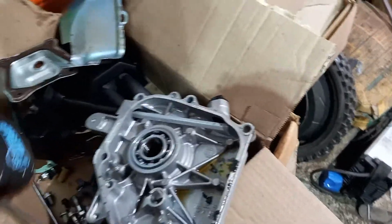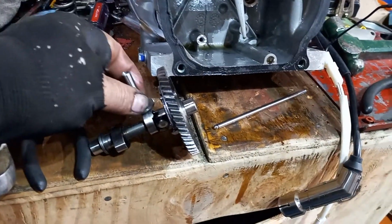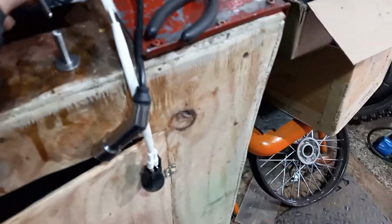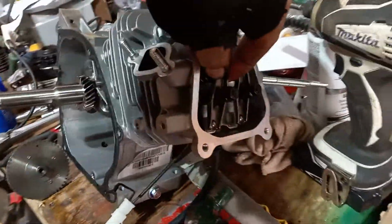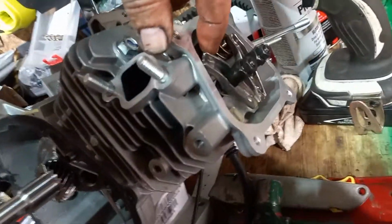Let me show you. They push these rods. Okay. So the lobe will push up on this, which pushes on this rod. I might as well keep this out because I want to show you something. Okay. Push up on this rod. Let me get it on this angle here. They push up on the rod. And then when it pushes up and down, okay? On the top, some have lashes, lash caps, and some don't. This is called a lash cap. I don't know if I can get it out of there.